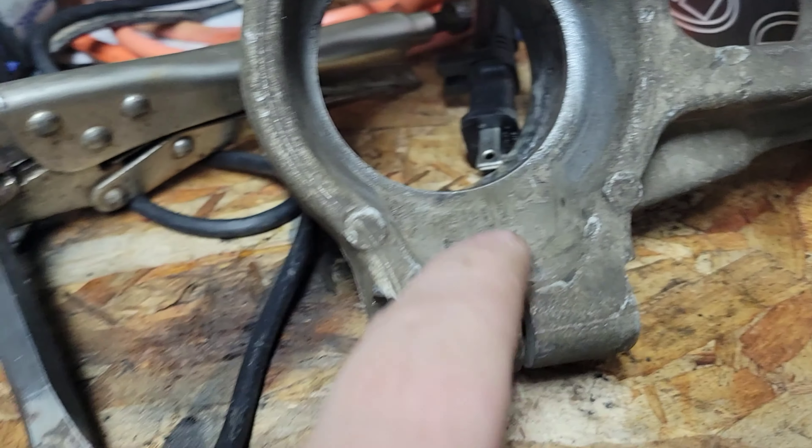I'm just going to call this done. This guy right here — if you have a vise, bring it in so it's sitting on these two lips. The lips here, and straight up — you can bang this thing out. It bangs out pretty easy. It does have a retaining clip there. I did put some anti-seize on it. So it does have that clip — you separate it to get it off, and then it knocks out pretty easy. And then to get it back in, all I did was just turn this thing around, board and hammer, and she just pops right in. So that's easy to get in, easy to get out.